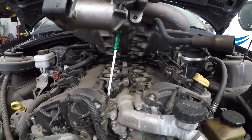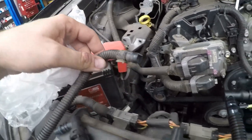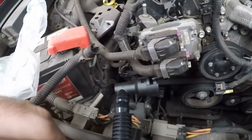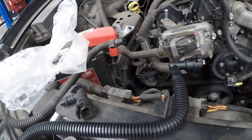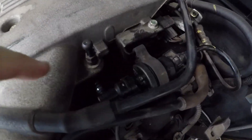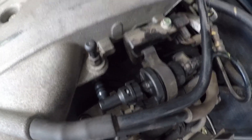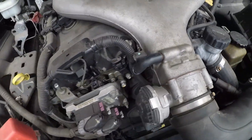Alright, we've got the intake manifold up and as you can see, here is the broken pipe — and here is the new one, that's what it's meant to look like. We're going to put the new one in, then get the scan tool on it, view some live data and check out the fuel trims. New part on guys — there's the brand new hose under there, runs all the way under the intake manifold.